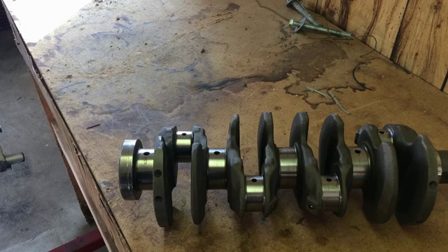I'm going to leave you a link to the main page of the ACL chart so you can find bearing specifications for any car — whether you need K-Series or even Mercedes, they're all listed there. Keep in mind this is just the basic inspection. There are all different kinds of bearing thicknesses and tightnesses for specific applications, but I stick with the basic stuff, and that has always done well even for higher horsepower builds. Until I start having back-to-back failures, I'm not going to reevaluate what I've been doing successfully for a couple of years.